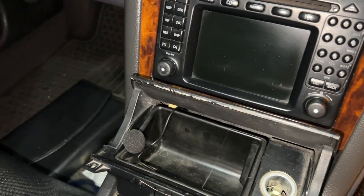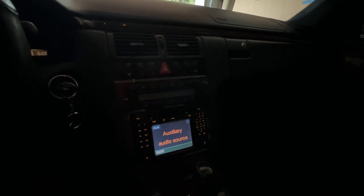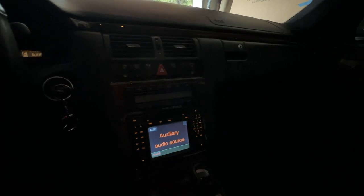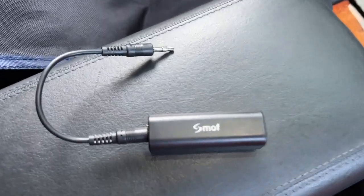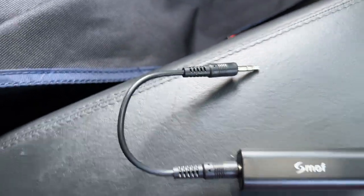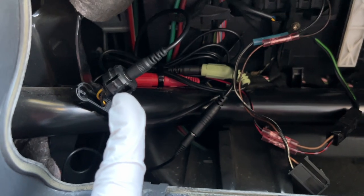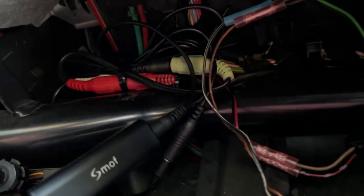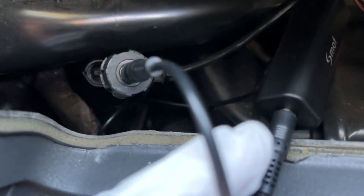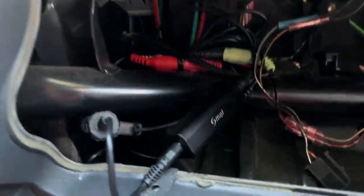The Bluetooth install was a success; however, we do have alternator whine and it is dependent on engine revs — when I rev it up, it alters the sound. I did buy an inline filter to cancel this out. This is the SMOTH brand noise filter from Amazon — I'll post a link in the description. I'm going to plug the filter right where it goes directly to the car's auxiliary port from my adapter, then it goes into the car's auxiliary port.